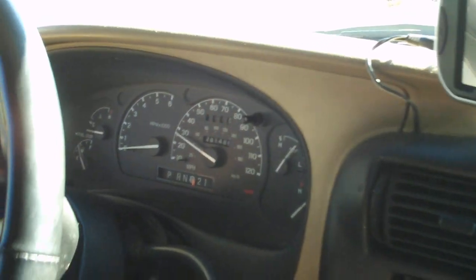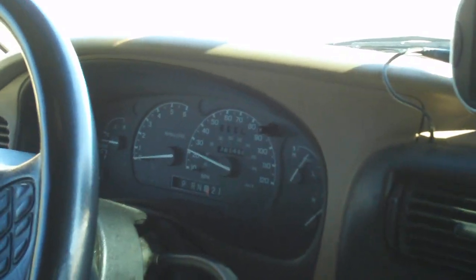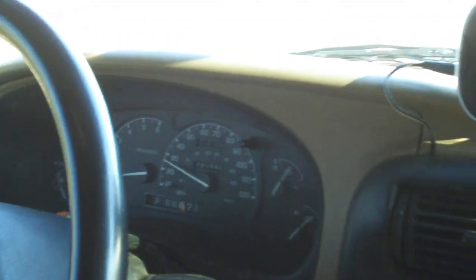Fuel pump and fabricated our own fitting to bypass, do away with the pump. We still have a sock and a pickup in the tank. We're still using the factory sending unit. All original gauges and instrumentation works, with exception of right now the tachometer.